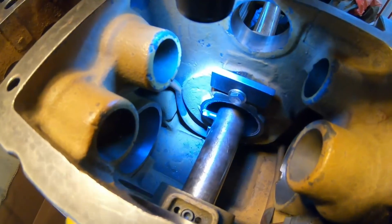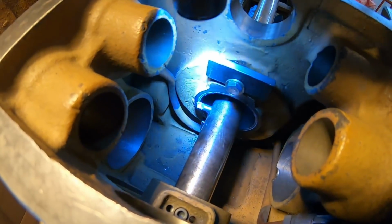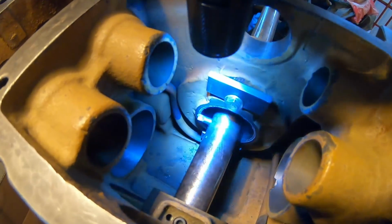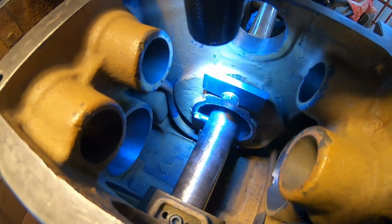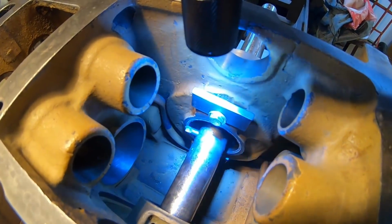So there's been some really good chips coming off that cutter bit, so I don't think I'm even going to turn the motor on. I might just feed this entirely by hand. It's a lot more controllable, and I'd like to do this cut in one pass so I'm not having to do a smaller diameter cut and then jumping out to a larger. Seeing as how I've got it set where I want it, we're just going to see if we can chew in by hand and see how far we can go.